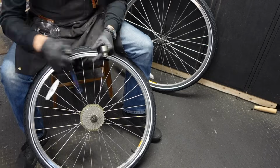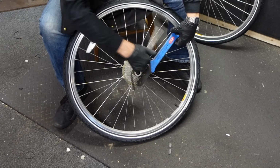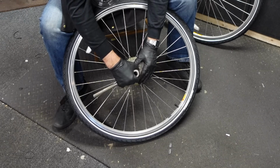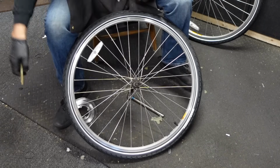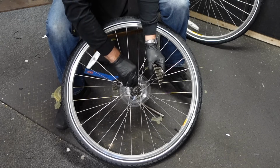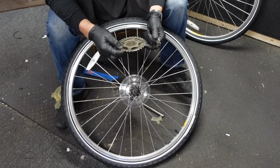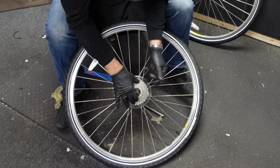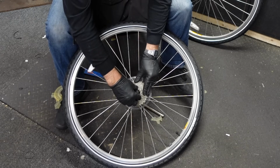All right. I think I'll refrain from giving you the spoke protector rant about why I think that's so important on these bikes, but basically, it's because I think most people don't know when their derailleur hanger's bent. It's going to force an overshift, and this will save them from having to actually repair the wheel when all the spokes get ripped off. And even put a new one on, it really makes things look pretty clean and fresh and new anyway. So I think that has a good aesthetic quality. I think it's just a shame that they got a bad reputation out there as being dork discs. You know, I've been a dork my whole life. Nothing wrong with being a dork. We deserve our discs too.